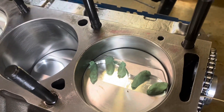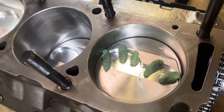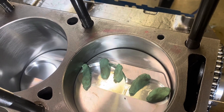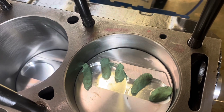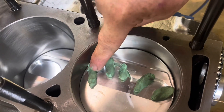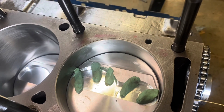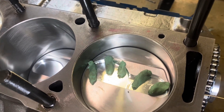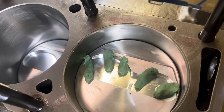I'm going to do a piston-to-valve clearance check. A lot of guys just smash big wads of clay in there to check it. I used to do that when I was first starting out, but my dad had a real problem with that. He thought there was a chance it could cause damage, so he started having me use little strips instead of big wads, so the clay would have somewhere to go. I can't see how you could bend a valve with clay, but they were using sodium valves back in the day, so I guess he must have had a bad experience. I do it with thin lines instead of a whole bunch.